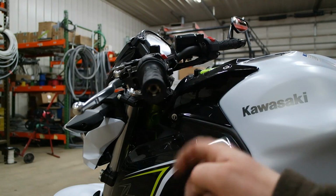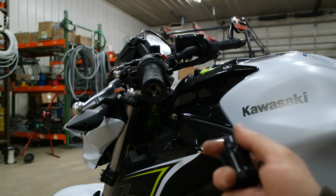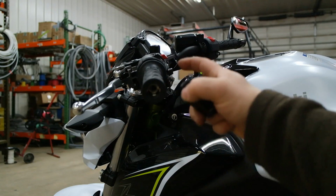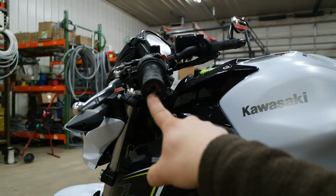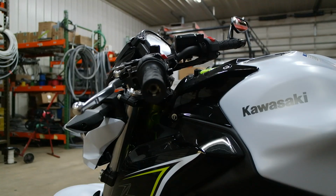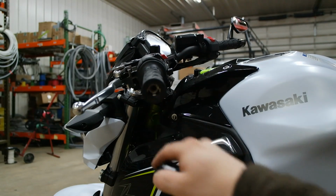Now, when the bar end came out, you probably heard or saw a little metal clip right inside here. This came out. That retainer is actually notched to keep the inside weight from spinning inside the bar. You want to make sure that you put this clip back in there. You want to make sure it's also straightened. If it gets warped, if this weight does twist or turn under the torque of you hitting or using the impact driver, just straighten it back out and snap it right back in there. You'll see the grooves. It's pretty self-explanatory.